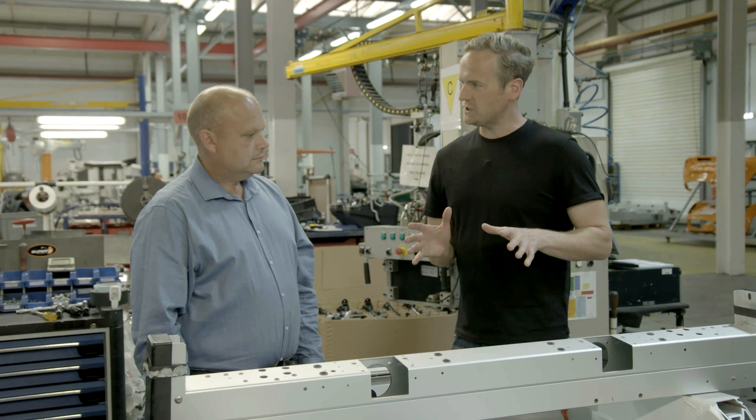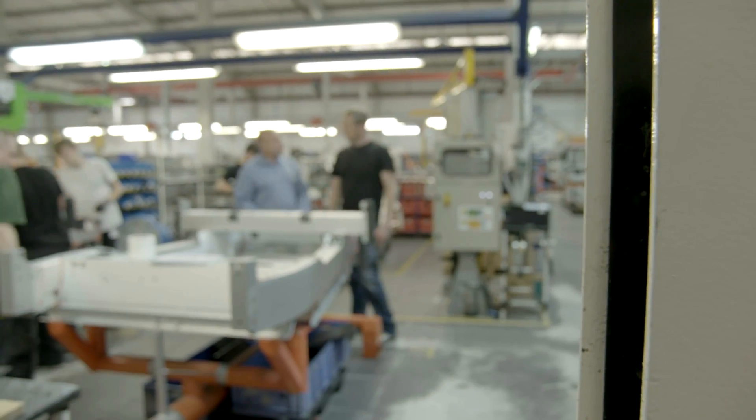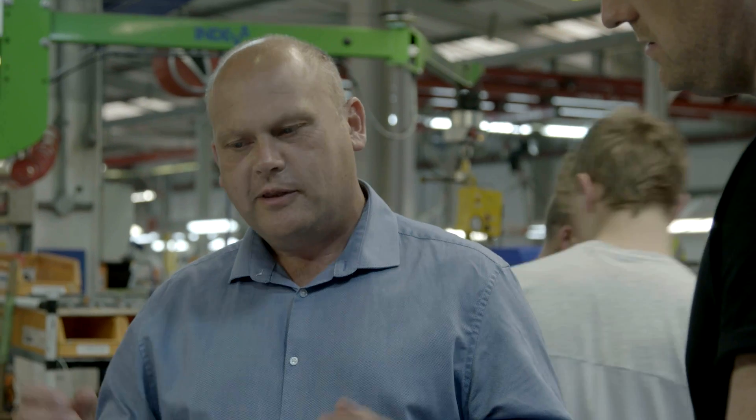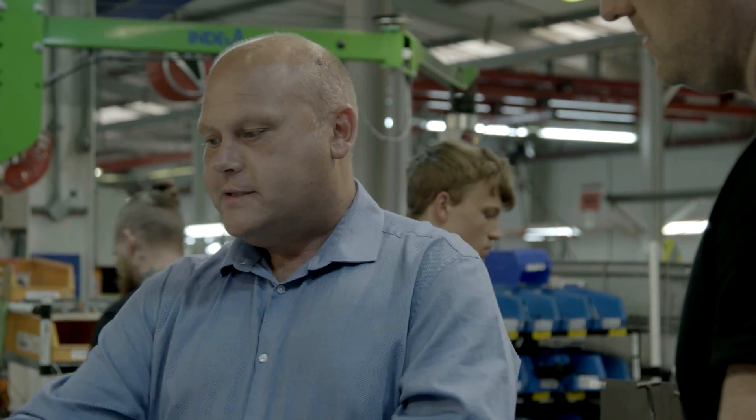What is this chassis from? This is from the new Elise, and it's a similar chassis to the Exige. How has it changed since the S1? Fundamentally the same — same architecture, bonding. It's testament that in 1997 we came up with this technology and it's still as modern today. With the introduction of electric vehicles, weight is your killer in a car, and if you can get something this strong in a modern, adaptable architecture, that's a real advantage.